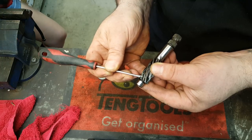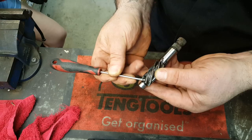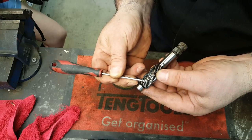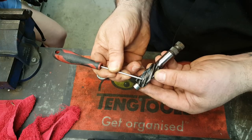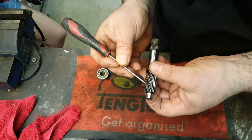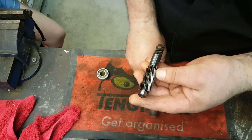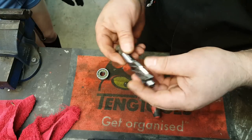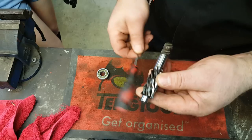So, basically, you've got a non-wear area here, and that's quite wide on the tooth, the peak of the tooth. And as you follow it down into the wearing area, that will obviously, over time, get thinner and thinner. If you also look right down at the base of the tooth, you'll see a ridge starting to develop down there as well. So that's an indication that it will wear, but how badly worn is it? And you've got to make the call, can we reuse it?